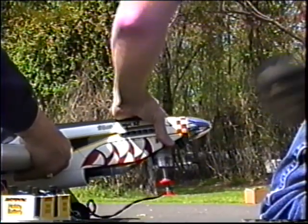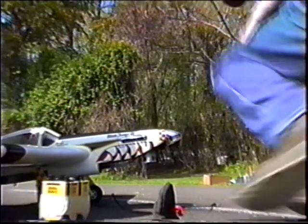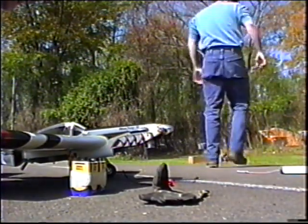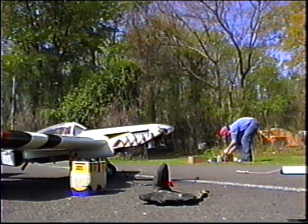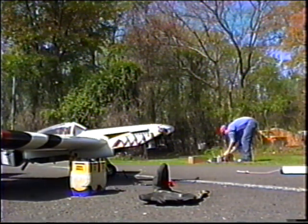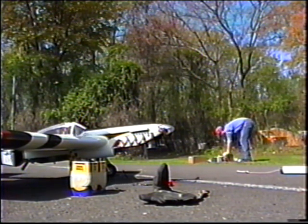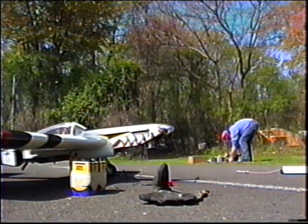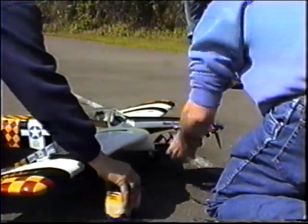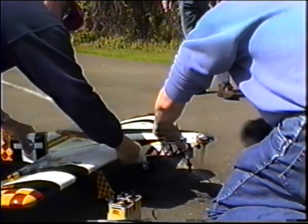A lot of times when it sits in the car with the pipe, the oil from the pipe will work its way back into the engine, if it's nosing down. Usually you feel a lot more compression. His sits nose up in the car. What Joe and I do is we put a couple of drops of lighter fluid in there when it gets all full of oil. That burps it right out. Try that. Yeah, it's dripping out the pipe, so that's something.